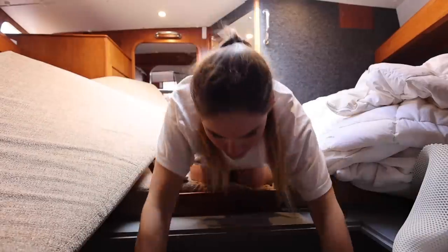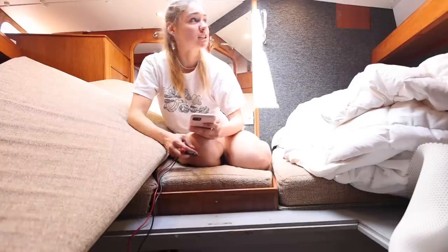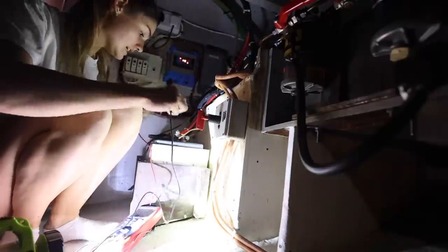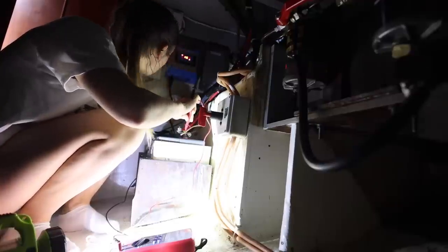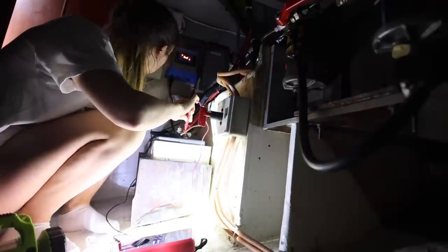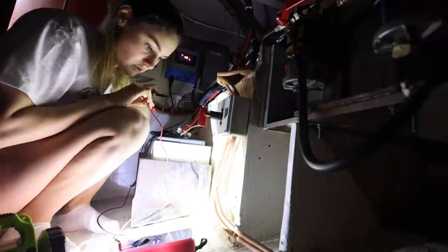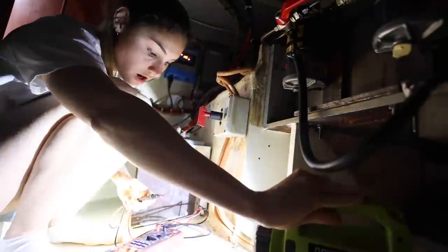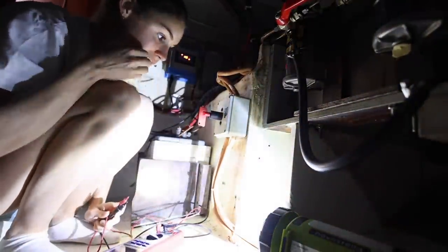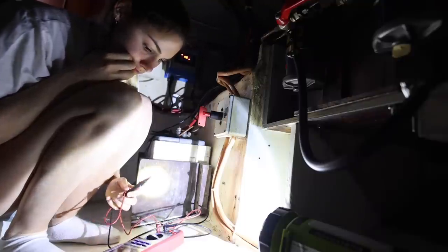Try pressing the range button — there you go. 12.33. It's like learning a foreign language. Number one is a starter battery. Should I see what the starter battery says? 14.63, which is basically what the charger reads — 14.5, so that's charging. That range is what you'd be expecting to see on the other battery, but that one isn't charging. So that's your problem, and it's likely something very simple — maybe a fuse, maybe a switch, maybe it's not even connected to a charger.